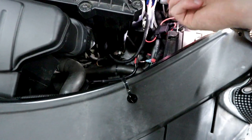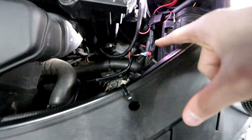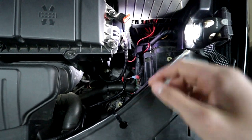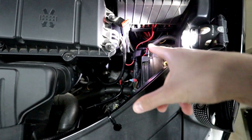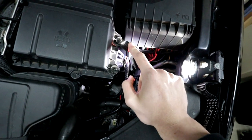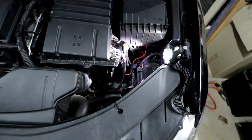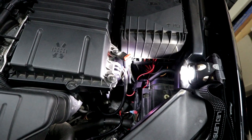The power for the light bar comes up and plugs into the back of the fuse. We get our signal from the green and purple wire, which is the high beam wire — we just use a T-tap into that. Power for the fuse box comes from a spare rail where every rail is positive and we tap straight into that. Of course I'm running an inline fuse from that. I also decided to get a fused relay as well, so we can be 100% certain there'll be no fire if something goes wrong. It's totally overkill, but having two fuses for one light bar is just peace of mind that this thing is not going to set itself on fire.